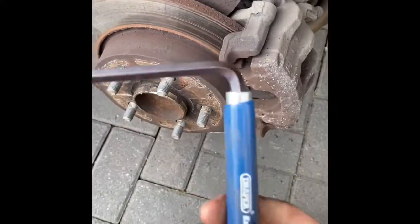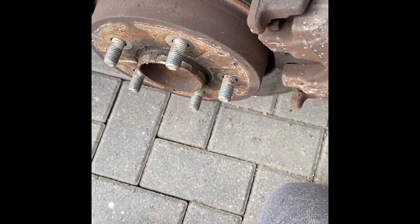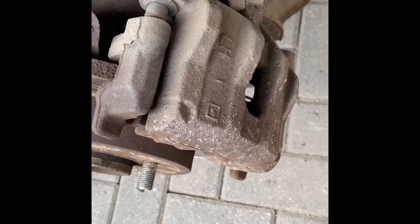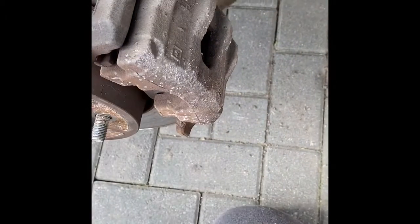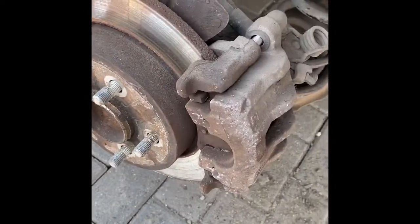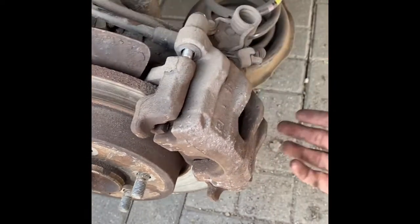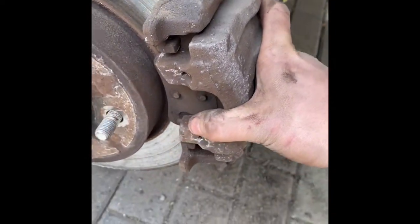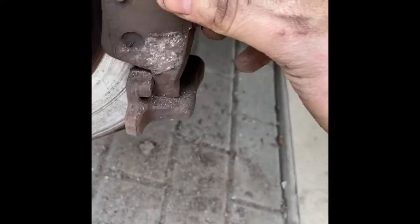What you're going to want is a 7mm brake caliper tool. Undo the top bolt and the second bolt — where the caps you just took off were. This is going to free up the caliper. Removing these bolts was a little bit tricky; there's not much room in there, it's probably about a quarter of a turn each time. Then you can just wiggle the caliper free and rest it somewhere so it doesn't fall, then take out your brakes.